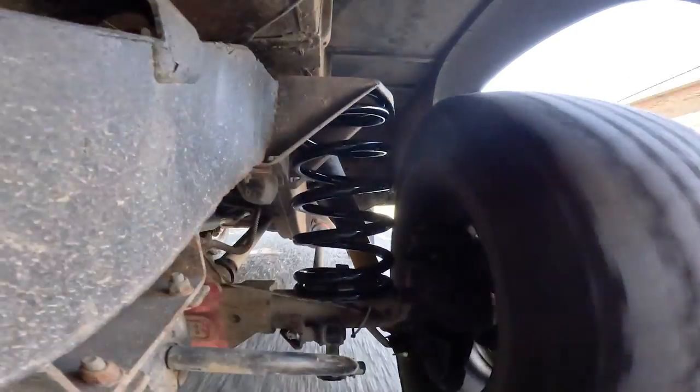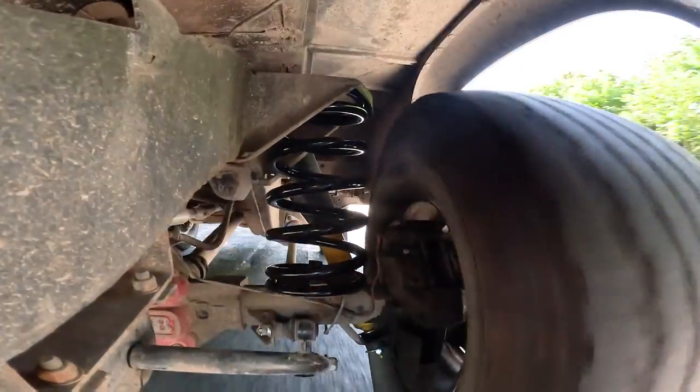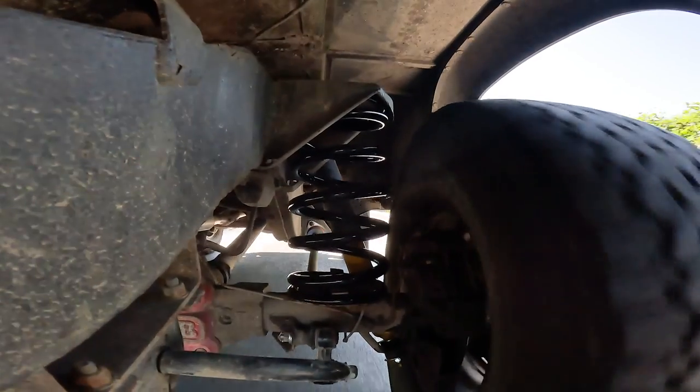Yeah, I'm really happy with this — should have done it in the first place. You might be able to tell from the GoPro underneath or from the shots I'm getting that there is movement side to side, but it's controlled. With the OME shocks and now these 500 kilo springs it moves but it's held, which is brilliant. It's coming up to probably three quarters of a year since I did my first change because I was unhappy. This time I've actually got a smile on my face — after maybe five or six different installs, this is finally it. I want to thank Brookwells for helping me out and supplying the springs — always helping out on the phone, which is fantastic.